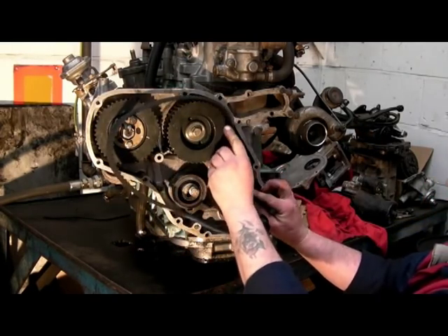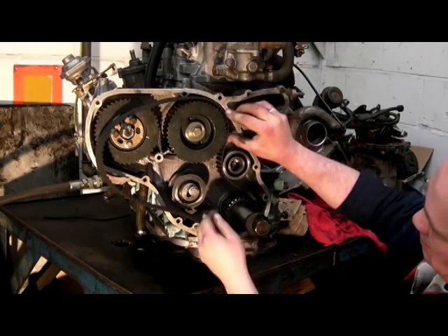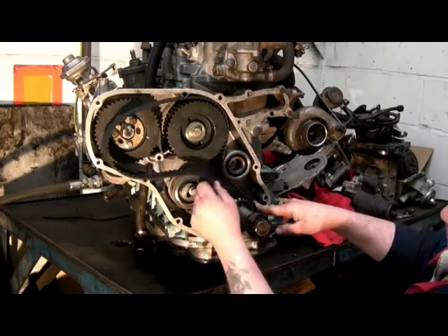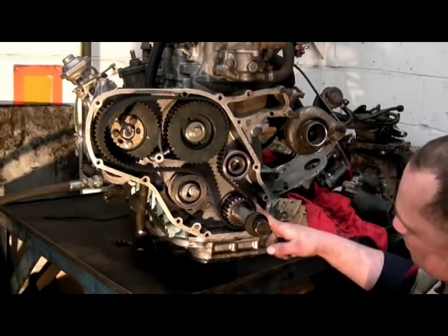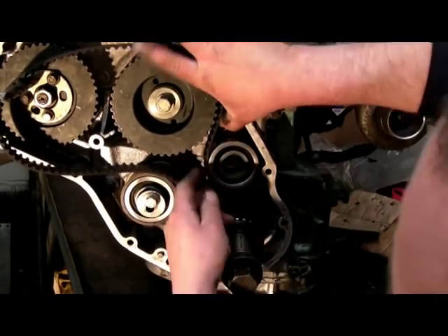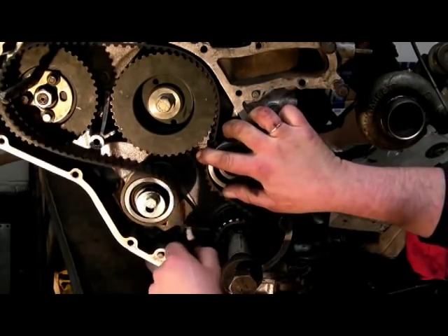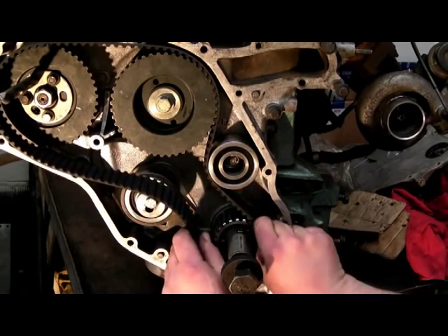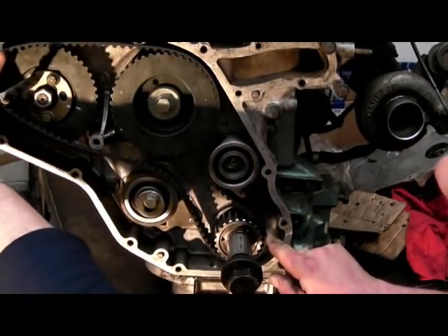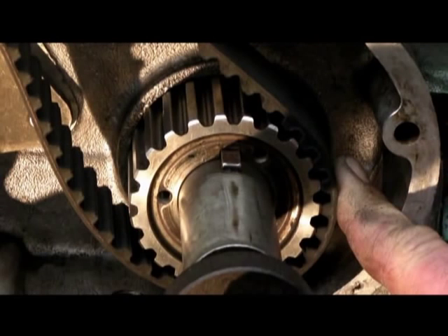Here's an old chestnut for you — fitting the belt starting with the right-hand side. That's the left-hand side of the engine, my right-hand side. The tension firstly on the right-hand side of the belt — I'm having problems here. It's alright trying to get it round the pump pulley. You get your teeth fitted into your cam pulley first — that's the first thing. That's in. Then pull it round and get your tension on the belt on your right-hand side. It's half a tooth out around this side — the crank is not set correctly.